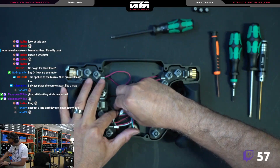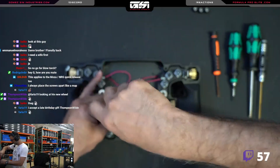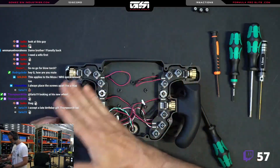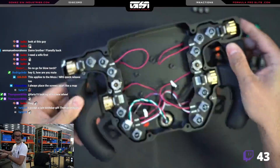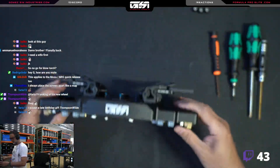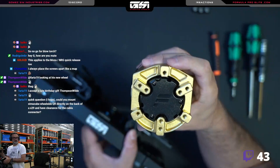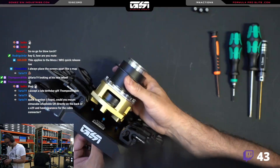This is why I like to do it by hand, just to get them going. When you're doing this, it's important that you don't slam into the buttons side to side — the actuators underneath could snap because they're only meant to go up and down. Now that we have all those in you can see they're loose. The F on the hub always needs to be facing up.